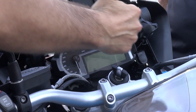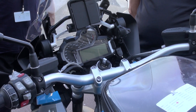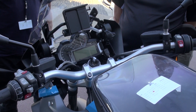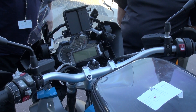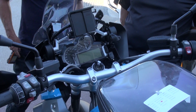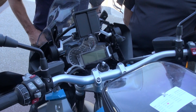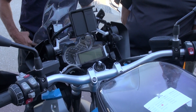With this mode button and your off-road settings, there's a lot less reason to deactivate. An ABS demo in rain mode on dirt versus the same demo at the same speed in enduro mode on dirt will have a much different effect, because the ABS is really calibrated to both situations. The road calibration is not as effective on the dirt, and the dirt calibration is probably not as effective on the bitumen either.